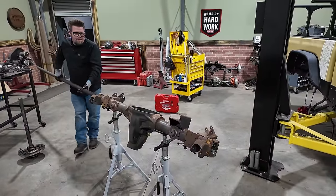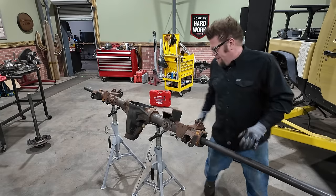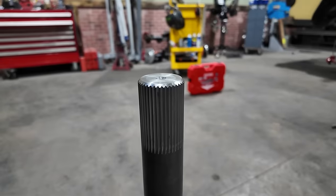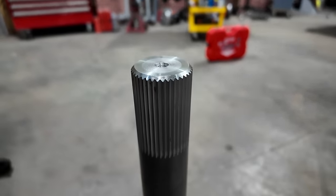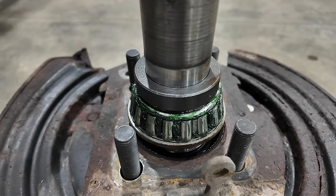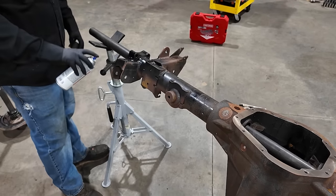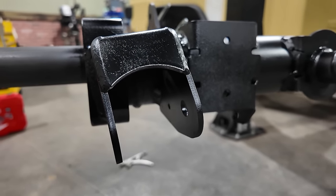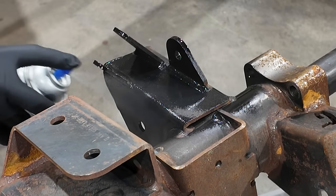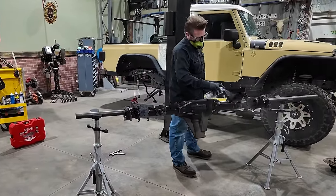So this rear axle is a direct bolt-in for the JK or the JKU, and it has a wheel mounting width of 65.375, which is basically stock width. As I said before, it's a heavy duty 60 series low pinion, so the ring and pinion are much stronger. And the axle shafts that come in the housing are 40 spline chrome moly. Now this is 2.5 times stronger than the stock shaft. The axle bearings are massive Set 80 axle bearings. Now these are much larger than the factory Set 10 bearings, which makes them stronger and able to handle more abuse off-road. All the brackets are in the stock location and they're heavy duty thick material. It has a nodular iron center section and a nodular iron differential cover, upgrades to a 1350 pinion yoke, but it still retains the stock 5-on-5 wheel bolt pattern and the entire factory JK rear brake components. And that's what makes this axle so easy to install.